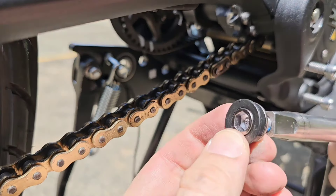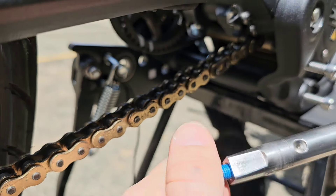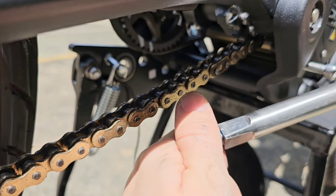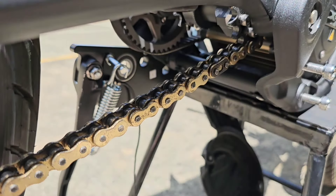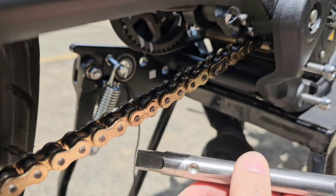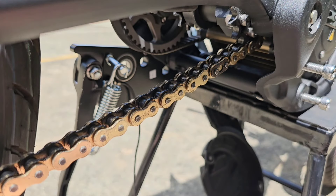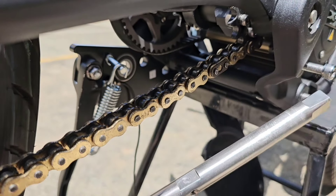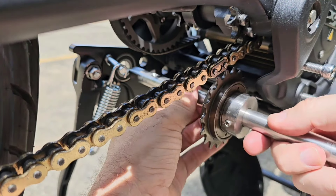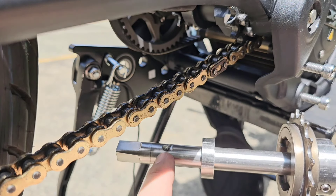Now we're going to install the spindle. We have a new crank fixing system using bolts that are standard and easily available at any bicycle store, and they also have incorporated Loctite — a great improvement. Take the collars that come with the spindle. The spindle has one side with a dimple that should be placed on the left side bracket. If you bought the power pedal kit with the freewheel, put the freewheel on now, facing this side. Then put one collar on between the dimple and the freewheel hub.